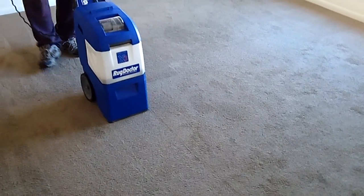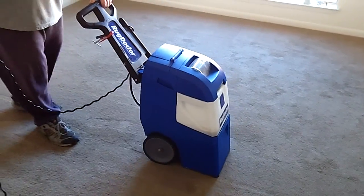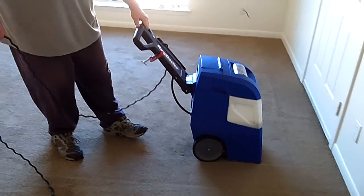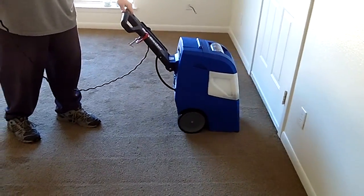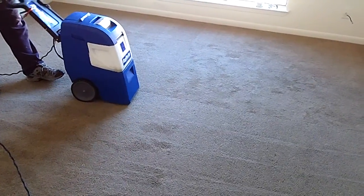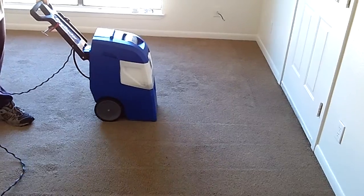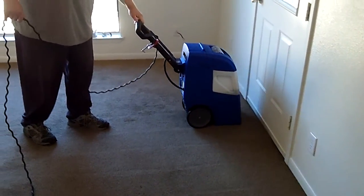These machines are really easy to use once you get the hang of them. What you might notice is he's got the handle not at the highest position — he's got it down a couple notches. That pushes the front of the machine down into the carpet, because you want it firmly on the carpet to get good suction. A lot of people leave the handle too high, the front end lifts up, and then you wonder why your carpets are wet. If you put it on the highest setting it makes it more like a dolly — it helps you lift the front end for transporting. So make sure you adjust your handle carefully for your height.